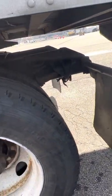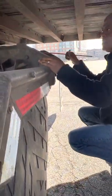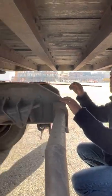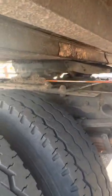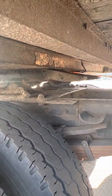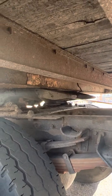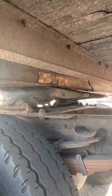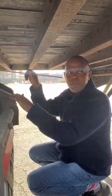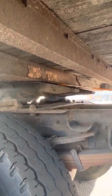When we go inside there is a coupling system. When you check the coupling system, there are a few things you need to mention — maybe four or five of them. This is a platform — platform has bolts and nuts, make sure it has to be tight and secure, no missing or loose bolts. This is a fifth wheel. When you check the fifth wheel, it has to be greased and lubricated properly. And the top of the trailer — which is the top of the fifth wheel and the trailer section — there is the apron; make sure it has to be greased and lubricated. When you do the inspection, make sure you should not see any kind of gap between the fifth wheel and the apron — the apron has to sit fully on the fifth wheel.